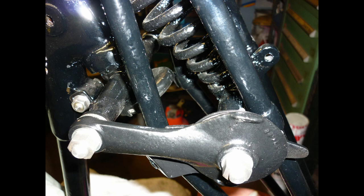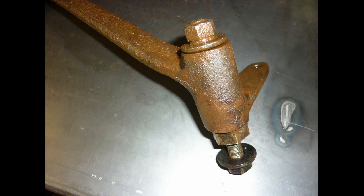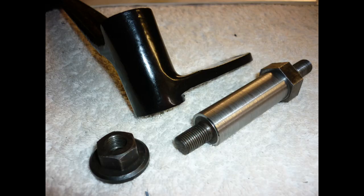The valve pushrods lack enclosure, the builder waiting inspiration. But the Red Panther is beginning to take shape. This is the badly worn brake pedal, another victim of an apparent post-war grease shortage. There was plenty of meat around the pedal's bore, so I've cleaned up oversize, skimmed the worn spindle and pressed on a sleeve, reaming the bore to size.